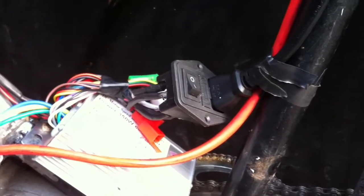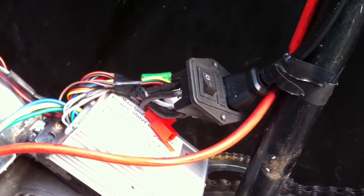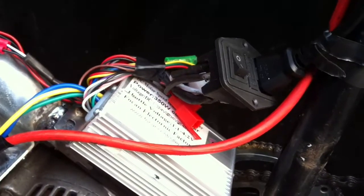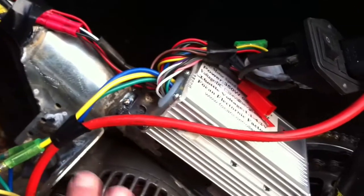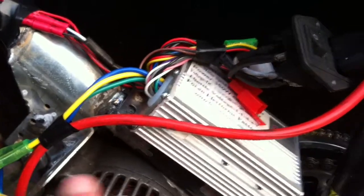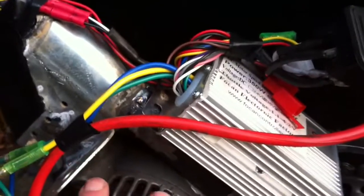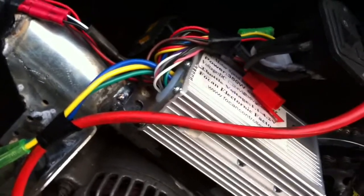The field is always on. So if I put the pulse width system on here, the field will go off when I go off the throttle. That should help to avoid any drag from this, which was really weird. And when I used the brake levers, I had regenerative braking on — so I'm generating through here with my legs, which is a little bit odd.